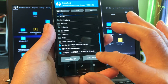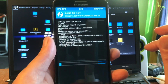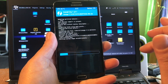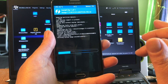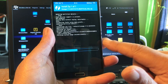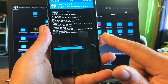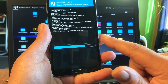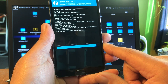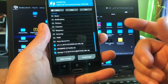We say install, and there it is — LineageOS 17 for the HLTE. I'm having a special version of TWRP; this is TWRP 3.2.3. And maybe I'm confused with the Galaxy S6 because I just made a video for that phone as well, or was it the G5? Flashing goes like a charm, as you can see — we're almost there. Boom, this is stock LineageOS, as you could see in my previous video.